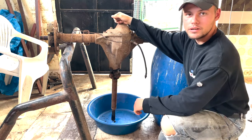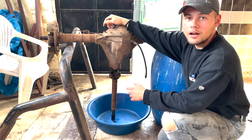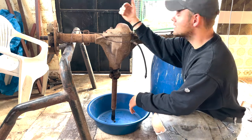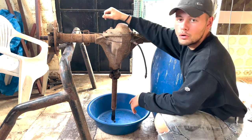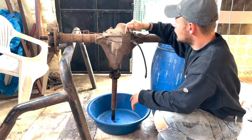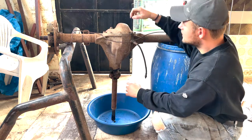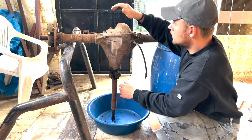Next on the list is the rear differential. I already went through the hassle and removed the hex bolts, which was quite hard because I didn't have the right socket. One side is a 41-millimeter and the other side is a 36-millimeter socket. I went to a local mechanic shop and asked them to remove both bolts, and they did. Now we'll remove the differential cover, get out the old oil, look at the gears inside, check if there are any teeth broken, remove the C-clips from the axles, take out the axles themselves, and clean everything.